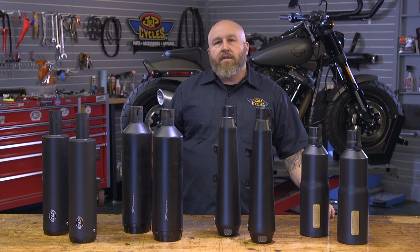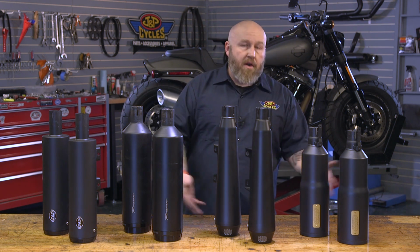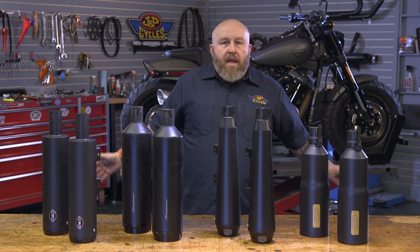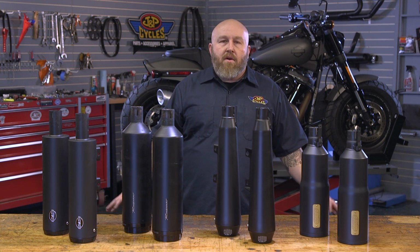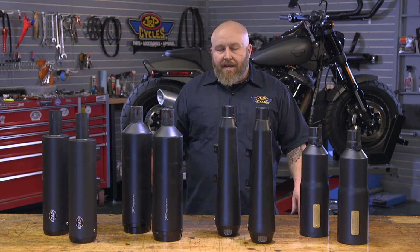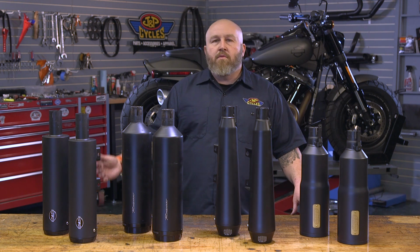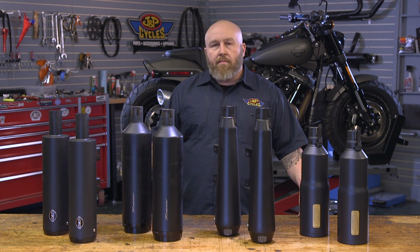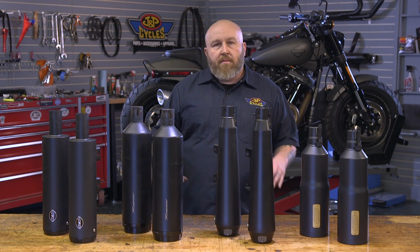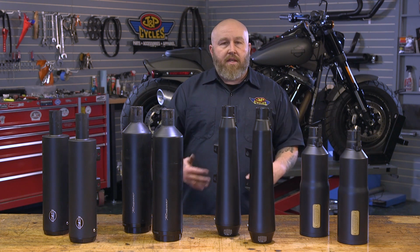Highly recommend you pair this with an intake. You get an intake, get a little more air in to get a little more air out, and raise up the performance of that bike just a little bit more. And I'll go ahead and answer the elephant in the room right now. Do you need a tune? I'm going to say yes. I don't know if it's a necessity, but it's highly recommended. And I say that even with stock bikes. Anytime you modify the airflow of these bikes, you want to modify the fuel curve to match. Something like an FP3 or a Power Vision is going to be more than enough to take care of your tuning needs if you do any of these mufflers.